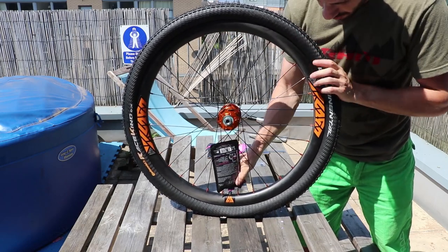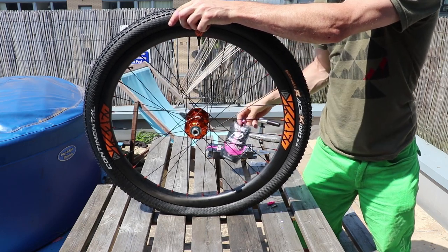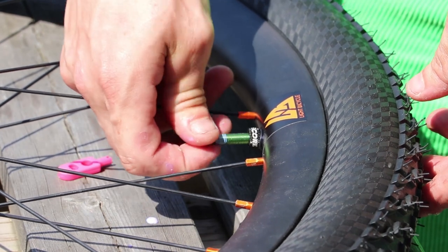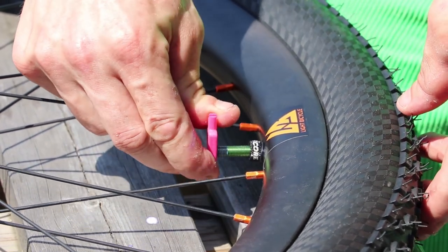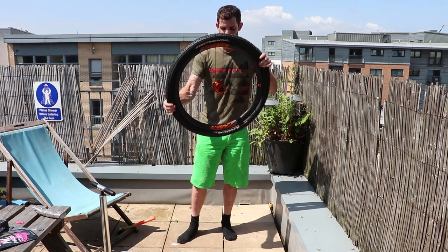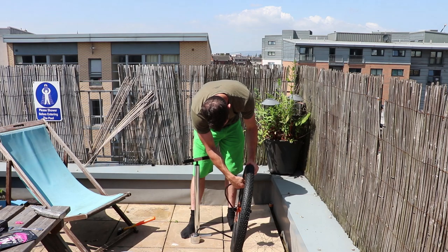That is actually really, really convenient — the kind of thing I'd keep in my bag when I'm out riding as well. Pretty cool, bit of a plug for Muc-Off there. Is this going to be mess-free? Often there's a bit of splashback but no — we're all good. That is sealant fitted to my tire, and it actually smells pretty good too. Then it's just a case of refitting the valve using a tool. I just need to pump this up now. Again just like last time, I'm going to use a normal pump — the beads are now all locked into place so this should go up even with the smallest hand pump. Give it a bit of a shake and a spin just to get that sealant spread out a little bit, then pump away.